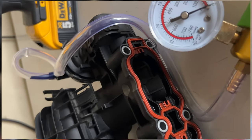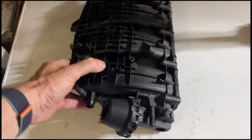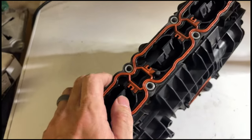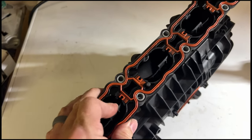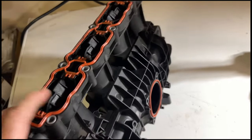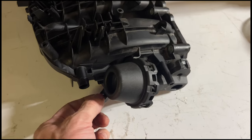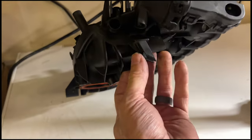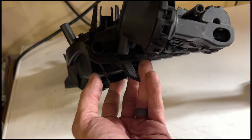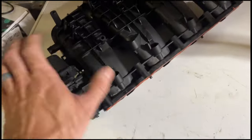The way I see it there are only a few things that can go wrong. The vacuum is what is used to close and open the runners — they're closed, and then when you apply vacuum it will compress and pull them open. Either you have not enough vacuum to pull them open, which covers all your vacuum connections, or there's a solenoid on the car that controls the amount of vacuum — on or off depending on the RPM, which I think is above 3800 RPM it applies vacuum, below 3800 it releases it.